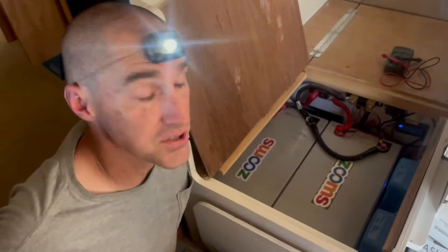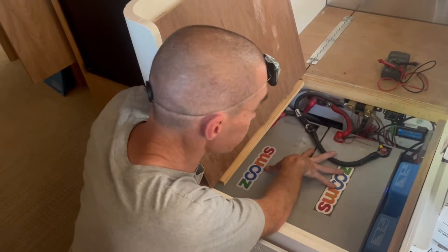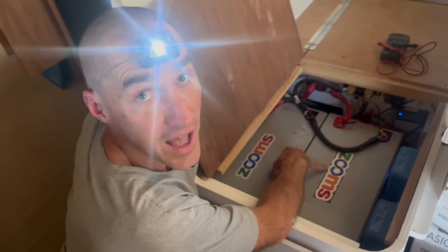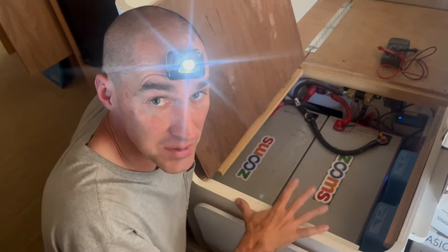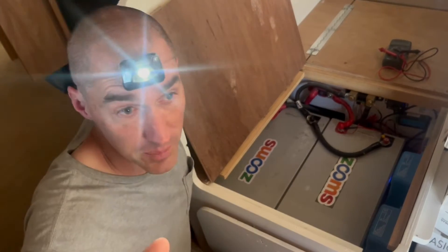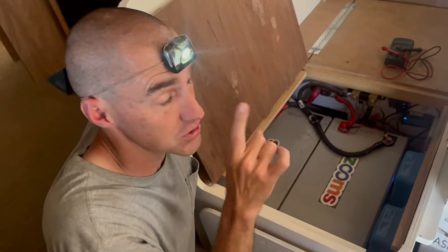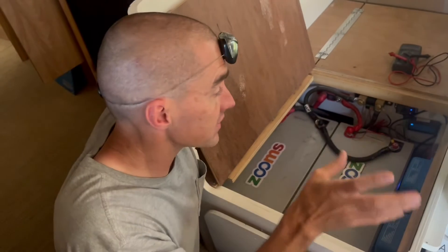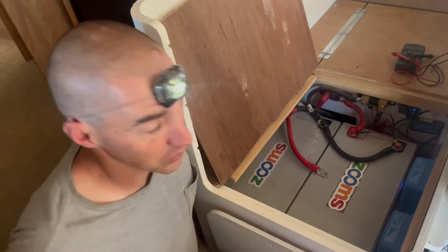Don't do what I just did. To safely work on installing the MPPT, I disconnected the batteries. I was very proud to see that my batteries had exactly the same voltage when I tested across them — not anymore. Our whole system shut down because we didn't have enough power, which seemed weird to me. I turned the company-provided generator back on and the 120-volt house current came right back, but we did not get 12-volt power back, which means something is wrong. I opened this up, looked at it, didn't see anything amiss, grabbed the electrical tester, saw weird voltages, and realized I had a problem.